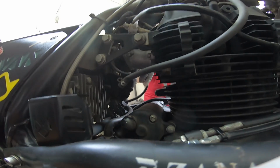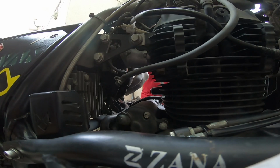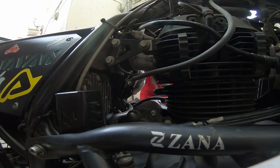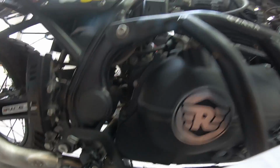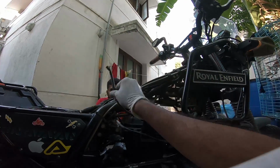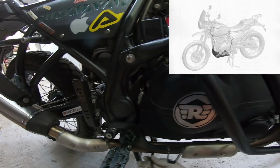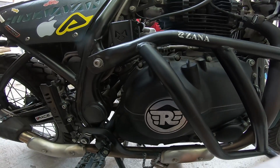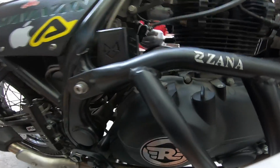Fantastic. Okay. As you guys can see, Sandeep is pulling on the top. Pull pannunga. Okay, there's another additional rubber hose that is routed from the throttle body. That comes right about here. The drain hose comes straight from the tank to the front of the evap system. Whereas the other hose that you see, which falls straight to the ground, goes to the evap system from the back. From the back, I repeat, from the back, comes from the throttle body.